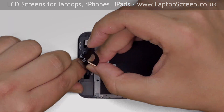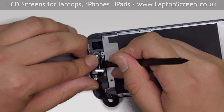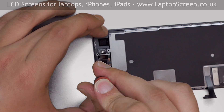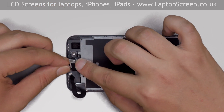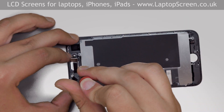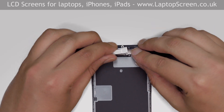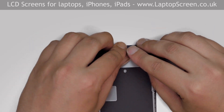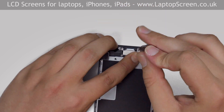Take the ribbon cable and carefully guide each component into its slot. Replace the one Phillips screw. Replace the speaker box and secure it with two Phillips screws at the bottom. Guide the camera into its slot and cover it with the small metal shield. Secure the shield with three Phillips screws.